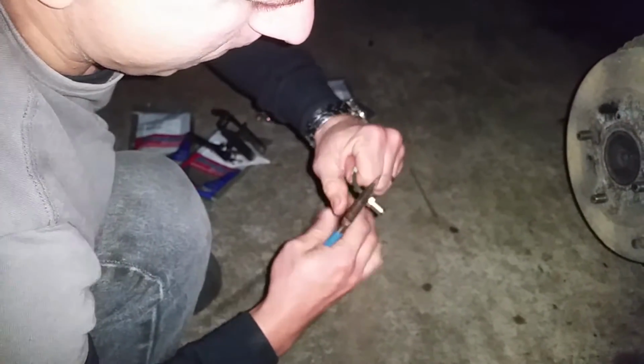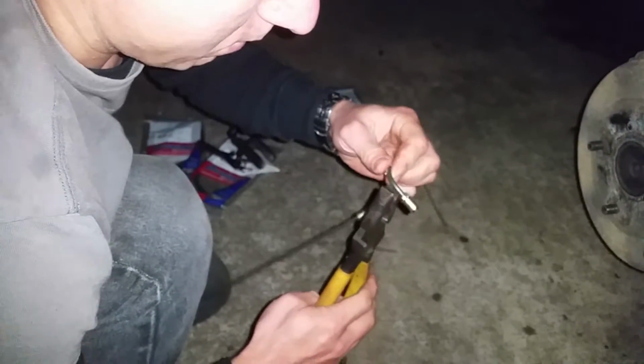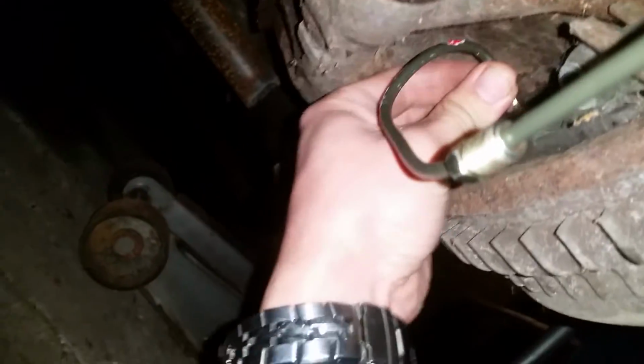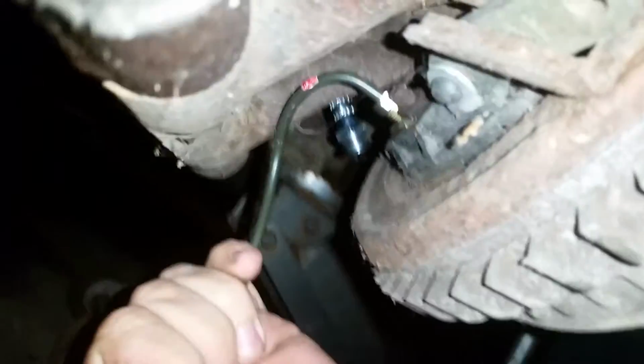I think what I'm going to do is go like so. Check it for a second. See that? Threads into the wheel cylinder. And I know that for a fact before I even came here from the parts store, because I brought pieces of the rotten rubber hose with me. I threw that away at the parts store. I would show you the kind of damage it has. So now it's loosely threaded in there. The flare can move, and I could use it to bend the rest as I need.